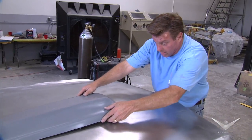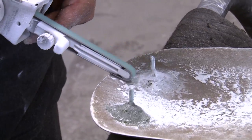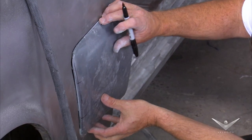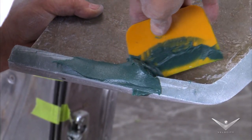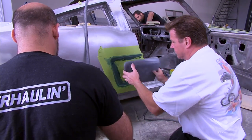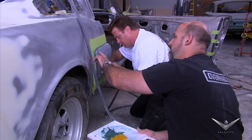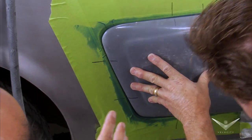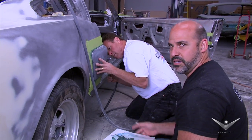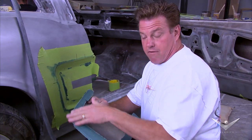Now all we've got to do is all the work it's gonna take to make that scoop look good. We're also installing two intake body pieces on the sides of the Mustang. Like the hood scoop, these pieces will need some modification to give them that Shelby look. One of the issues is just the gap, so Chip is laying some fiberglass on the backside of it so it's gonna be a nice tight fit once it's done — and now we have a fit where that part fits right to that.